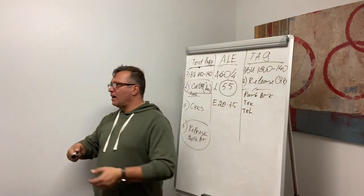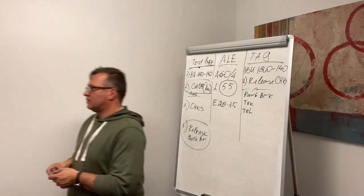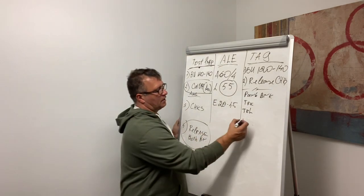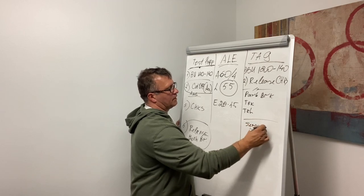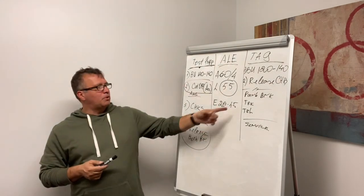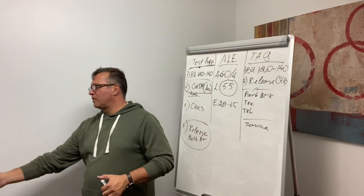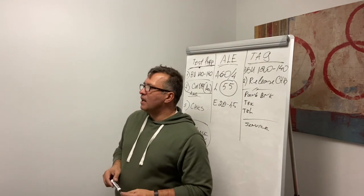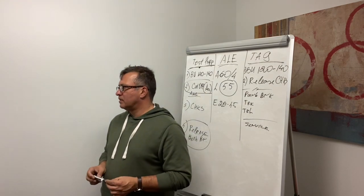You pull the trailer, you push tractor. Do the same. Working properly. Now we need to check, what next? Service, to check the service brake. We need to release parking brakes, all of them. So which one is pushed, which one is pulled, push it, make sure both of them are pushed. You will need to accelerate to 5 miles per hour. 5 miles per hour, it's a lot.